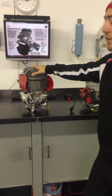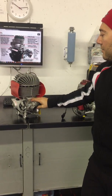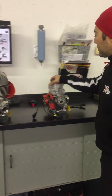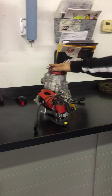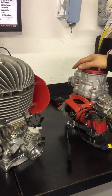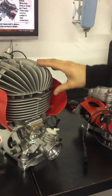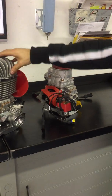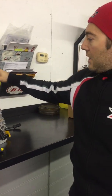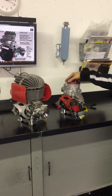That's a great feature. Now the really great thing that we're excited about is that this engine, by simply removing the cylinder and the head, converts into the water-cooled X125WC. So these two engines here — for people who are juniors or seniors who start out in the air-cooled — they've got the unique ability to go from a 100cc engine and simply by changing the cylinder and the head, you can run the water-cooled class and go to a 125cc.